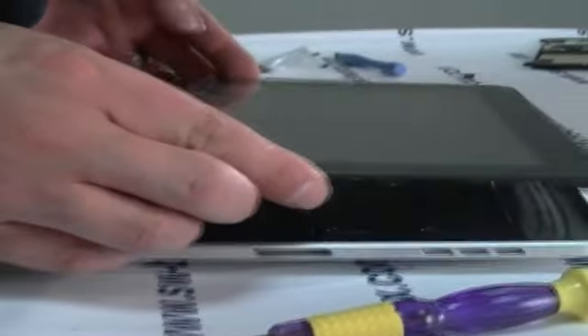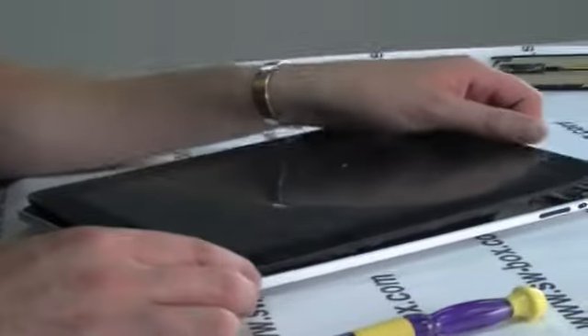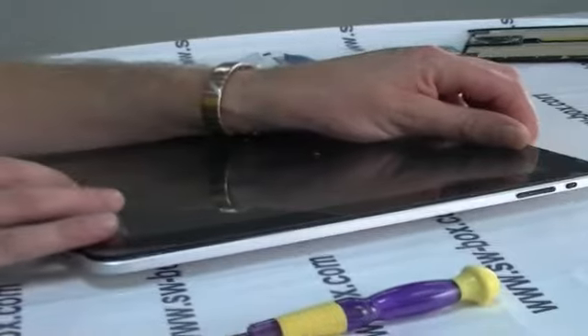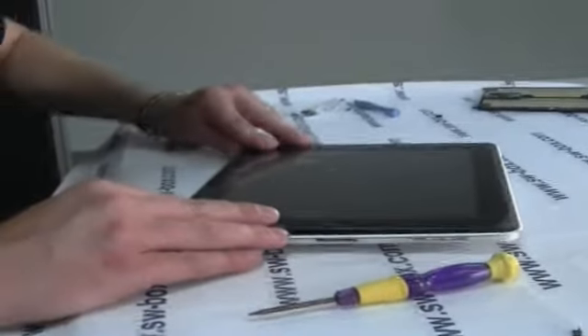How many of these clips are we talking about putting back into place? Three, basically — three sockets to go back in. Not all of the clips snap. There's a line of plastic ones on the front end that don't break, so you haven't got to replace them — and it's always best to push them in first. With the metal ones that sit underneath the lip, all you want to do is push them in a little bit because you force them out.